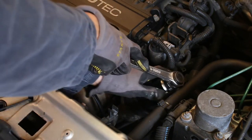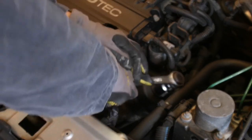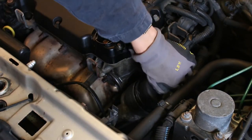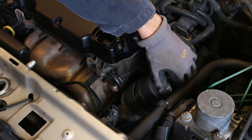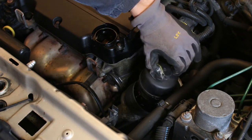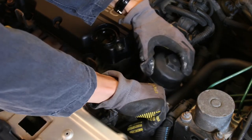This is also the moment to change the oil filter. All you need is your ratchet and socket, and a few turns should break it loose. In my case the oil filter is located on top of the engine, which means when removing it there is quite a risk of spilling oil all over the floor, so make sure to use some newspaper or towels underneath to catch any leaking oil.